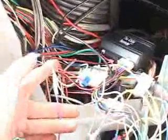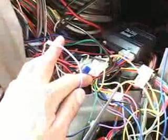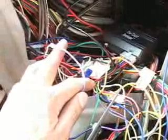The violet wire, in this particular bus, we have an air door, so we've run an extension wire to the violet wire and sent it on over to the header above the door and installed the optional air door switch kit, ADK1, in this bus. If this bus was equipped with a manual door, this violet wire would simply go to the door input on the bus's 8-way warning light flasher.